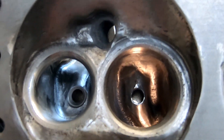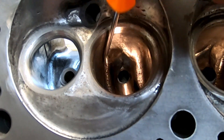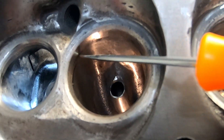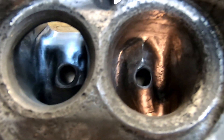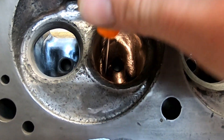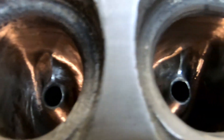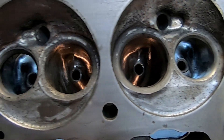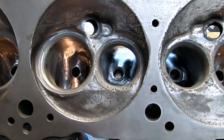Here's our valve side. I just did my best to bring the guide on down, open up through here. I did not take it out past my marks — you can kind of faintly see through here. I just gave that nice little tail in. I didn't get it too deep into here, it's still got some flashing. Brought it on around, tried to tighten that up real nice. I don't think I hurt these small block heads too bad, and they still need a lot of love. It's up to Ed and Ed's machine to get them finished up for us.